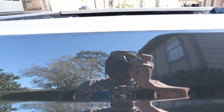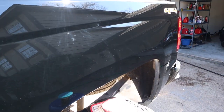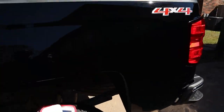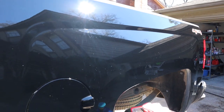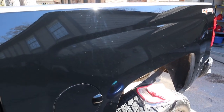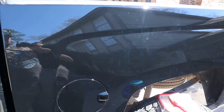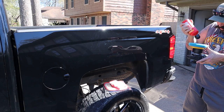Let's see the reflection. So I've got a couple of holograms in here — you can see them right there. We're going to swap to the blue pad; it's less aggressive than the orange pad. We're going to take the same Griot's polisher and do a quick once-over — maybe twice. I want to remove those holograms and make this thing really pop. There's like a little smoky haze to it; got to remove that haze. Just a little bit of product is all you need.